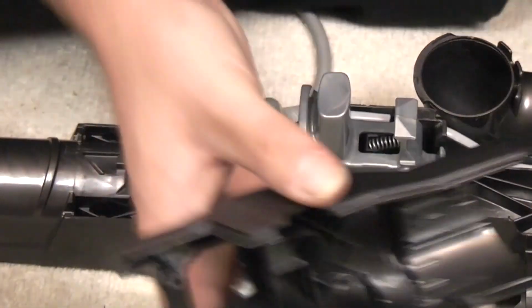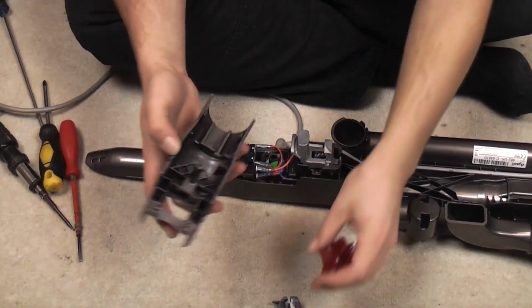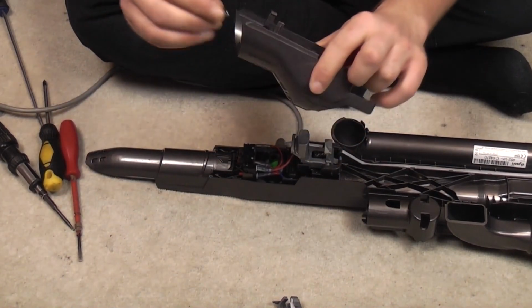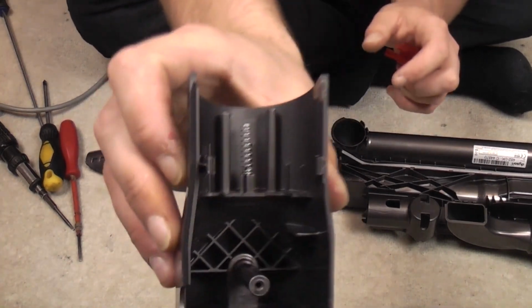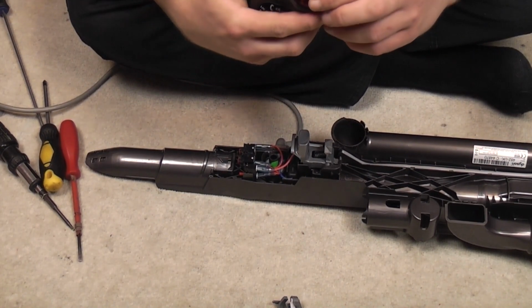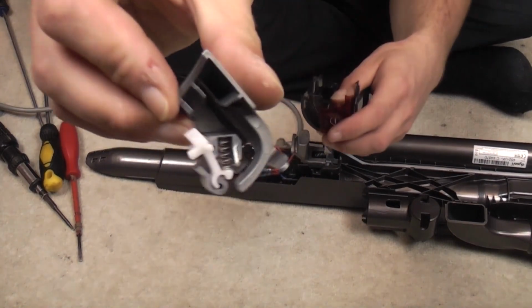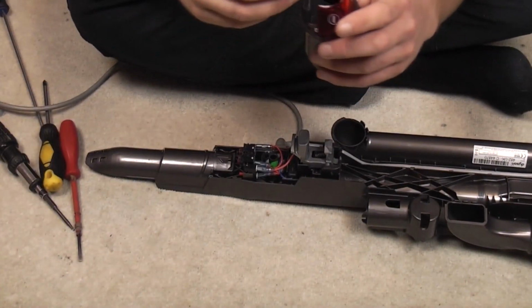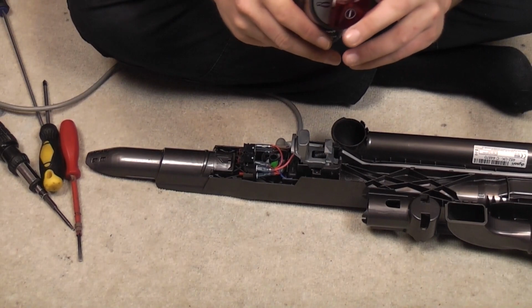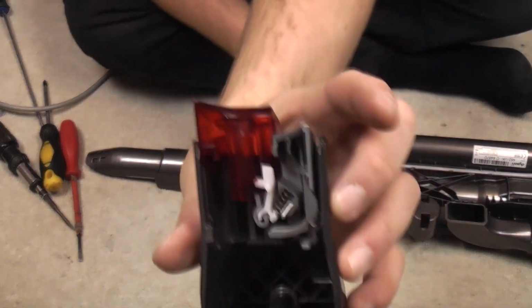Now we can get the switch housing, bring it back a little bit, and the switch covers themselves very simply. The red one has a spring, the actual mains on-off switch has a spring. This spring sits on there first. Then slide the mains on-off switch into position. The brush roll on-off switch has the plastic cam and its spring fitted, and in fact I think it actually goes on first. Yes, it does. And it ends up with that basically.